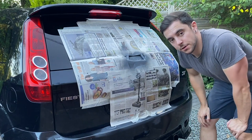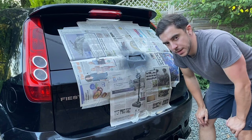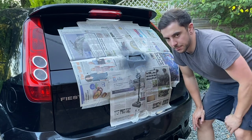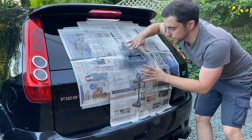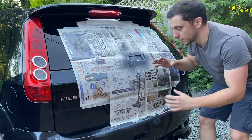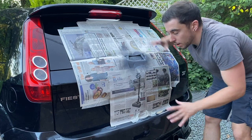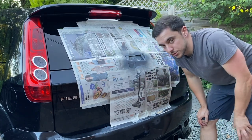So that's the third coat of primer and I think that's going to do it for now. I'm going to do probably about three or four coats of base as well, but I'm going to wait a little while for this to dry off because I do want to sand it back just a little bit. I'm also going to move the folded paper out a bit wider so we feather in a bit better and make sure we cover everything, and then move it out even wider when we do the clear coat.